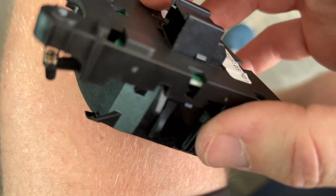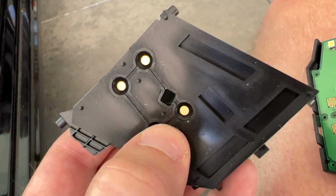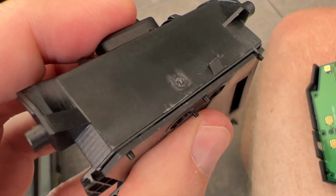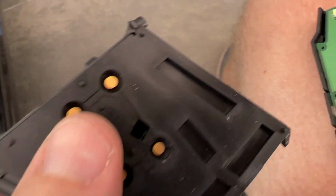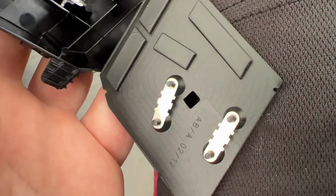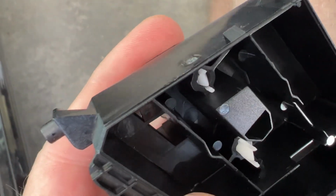All right, you know, as my bonus for broken parts, I just pried around all of the edges to open this thing up so we can take a look inside for those curious. So here's the back side of our button. It's got this rubber piece on it, and then our rocker pushes these little contact points in and out to make contact here, it looks like. And there's a little LED that shines through this opening to illuminate the button. So if we peel that back, those are the contact points. And these are the little plungers that push them.